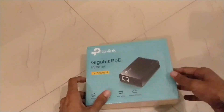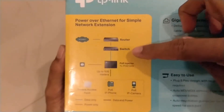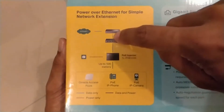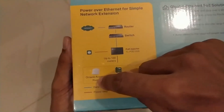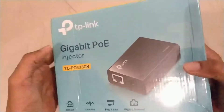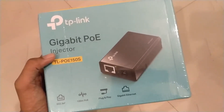Let me show you a brief diagram. We'll set the splitter aside and just look at the injector. Typically, you have a router, a switch, and then a POE injector. The injector is connected to a power source, you have one ethernet cable going to the switch, and another ethernet cable going to one of three POE devices — which can be an IP phone, access point, or a POE IP camera. The difference between this unit and others is that it supports gigabit ethernet, which is important when selecting this type of product — you need to decide whether you want standard 10/100 or gigabit 10/100/1000.